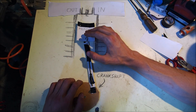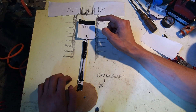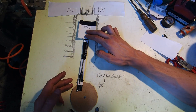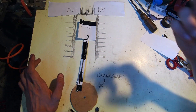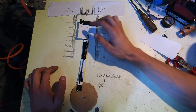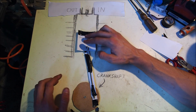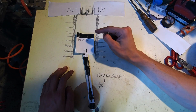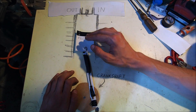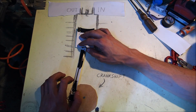The best way to kickstart a big bore four-stroke is to put the piston right after top dead center, so when everything is still closed but the piston has basically one and a half turns to do without any obstacle. At this point you want to kick on your kickstart lever so that the piston goes down, up, down, and now another compression stroke begins. After one and a half revolutions the crankshaft is going to have enough momentum to let the piston pass through the compression stroke and begin a new cycle again, and basically start the bike.